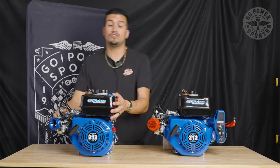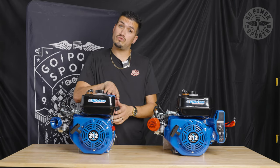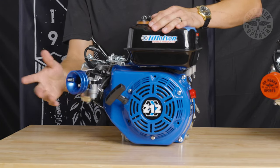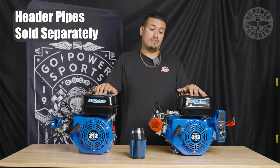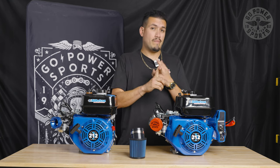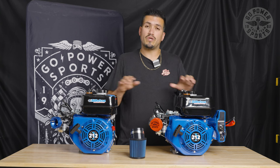For the pull start, of course you don't get the electric, but you will get the governor removal on this one as well. You'll get the self-tapping bolt in there, you'll get your jet, your carb gaskets, your adapter, and another filter in there. Stage 1s do not come with pipes — they give you options. The reason we give you options is because we don't know what application you're putting it on. You can be putting it on a go-kart, minibike, doodlebug, or Coleman. We don't know what you're putting it on, so we give you an array of options.